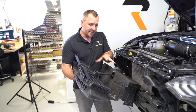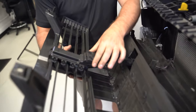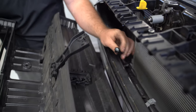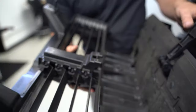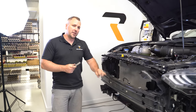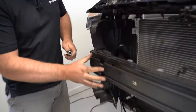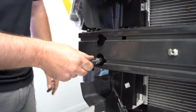On the back side of the air vent system, once those two bolts are removed it slides out of the way, revealing a final connector attached at the bottom of the air vent system that you need to detach. Get the arm out of the way to access that connector. With the air vent system off, you now have access to the crash beam. Use a half inch socket with a small extension to remove the two bolts attaching each side of the beam to the chassis.